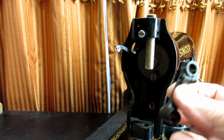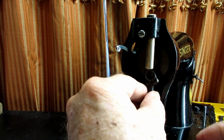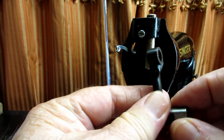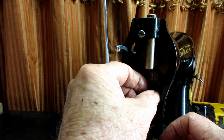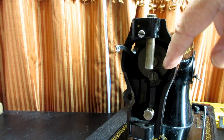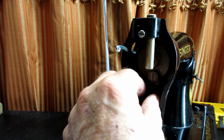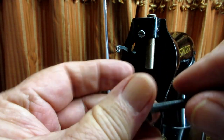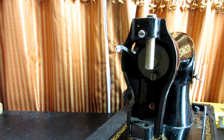It's okay — that's how it goes on. And it has no fear of falling off because when your connecting stud is in there and it's on the connecting link hinge screw, and your needle bar's through there, nothing can come off. The needle bar holds everything in place. So I got that off and I'm going to go ahead and clean everything up a little bit.